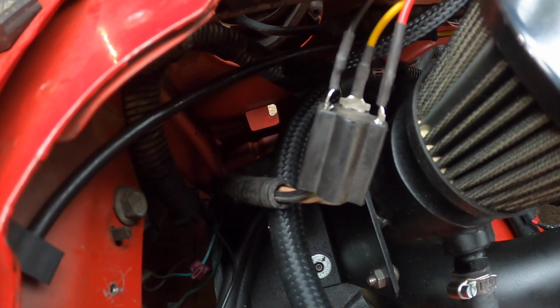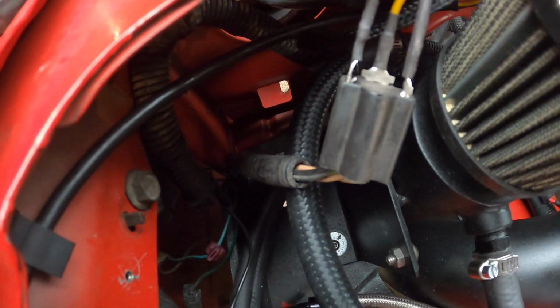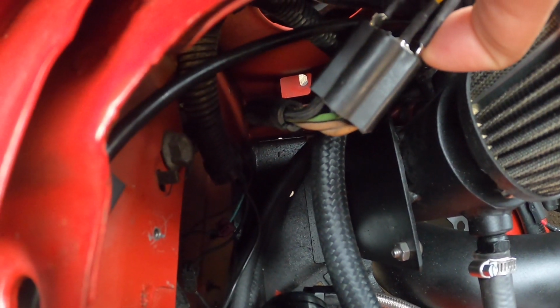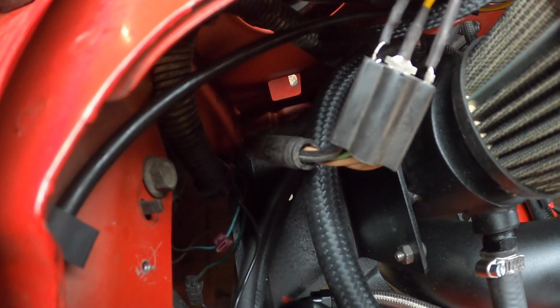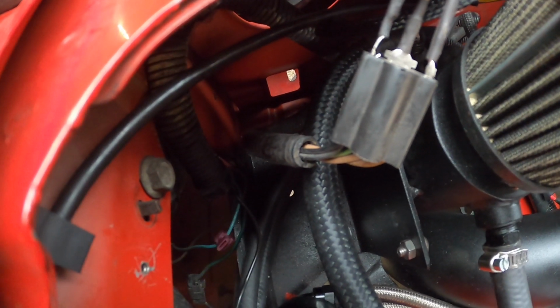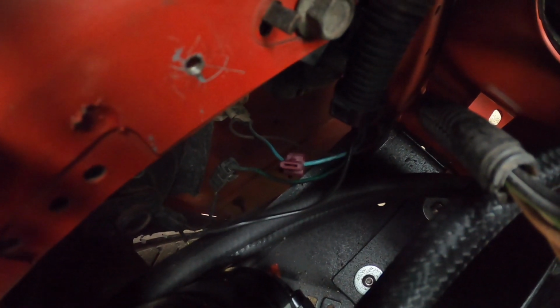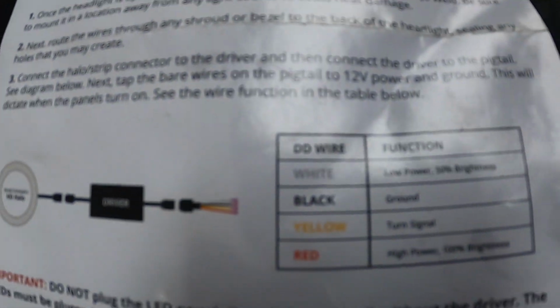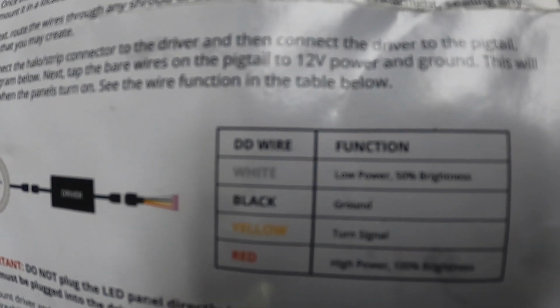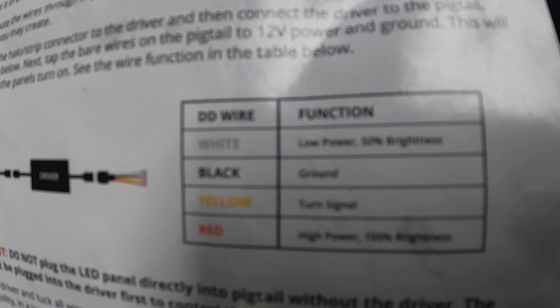It's the next day. Lost my daylight yesterday working. The factory driver's side harness has green, black, and tan in it. I can't remember which green and brown is at the second, but I'll add those colors in the description. You see down there where the purple clip is on the light blue wire. That is your turning signal, so you can also tap in there. Dapper sends you a kit or instructions that gives you the information of which ones you need to go to.